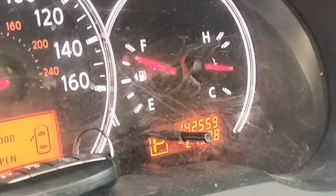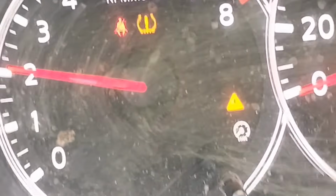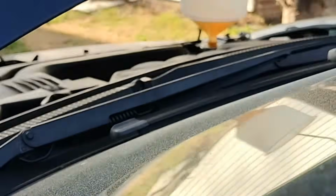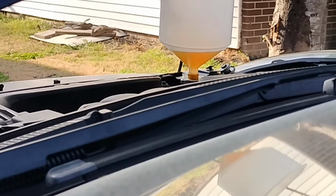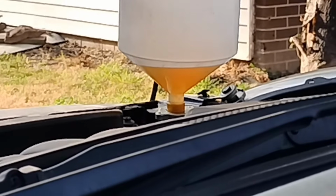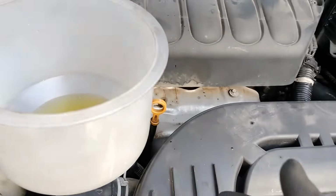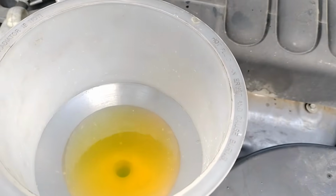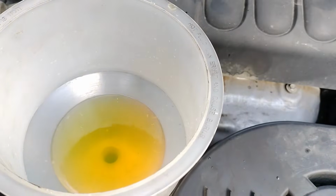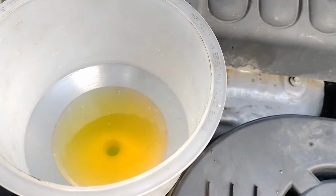It's hot enough, so it means that your coolant is traveling through the system. It's fine. Try to keep your RPMs around 2000, not higher if possible. After you have confirmed there are no more bubbles, if there's a little bit of bubbles just coming here and there, and it takes longer to bring more bubbles up to the funnel, then that will be enough.